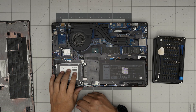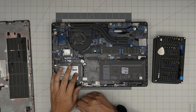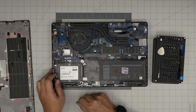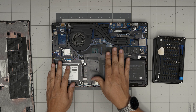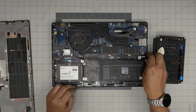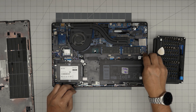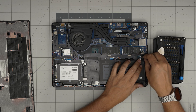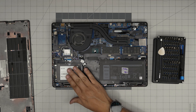I can see that somebody already upgraded the SSD to a one terabyte Lexar drive — they probably had a mechanical drive originally. To remove any storage or upgrade RAM, you do not need to disconnect the battery; it's absolutely not necessary. But if you want to, just pull the handle upward and the battery will disconnect. To reconnect, align it and push it back down.